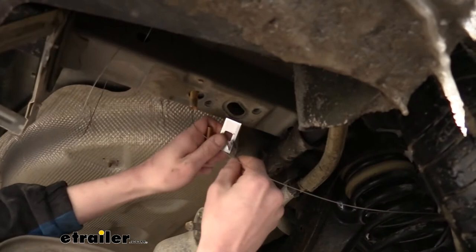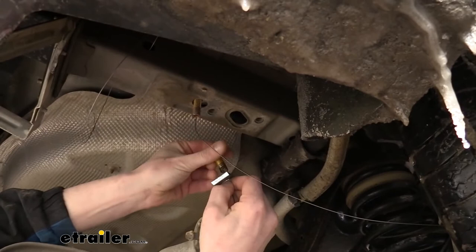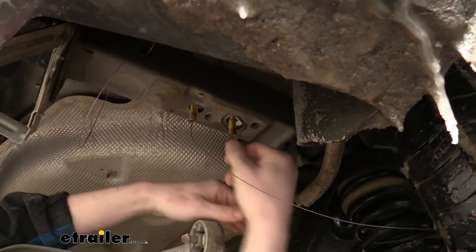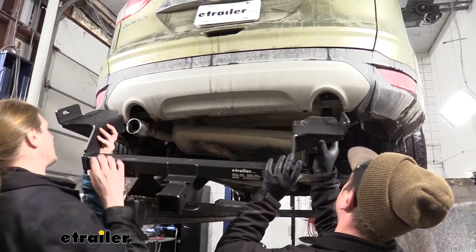For our reverse fish wire technique, take the spacer and put it over the coiled end of a fish wire, then thread our carriage bolt onto it. After you've got the carriage bolt threaded on, feed the pieces of hardware into the frame one at a time, then just pull it right back down. Now we've got all of our bolts fed in on this side, and we're going to perform the same procedures on the other side to get the hardware fed in the same locations.